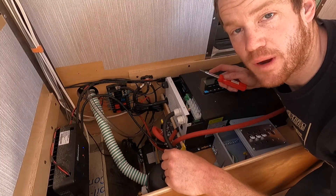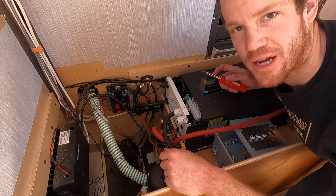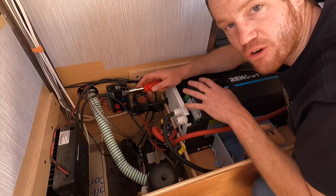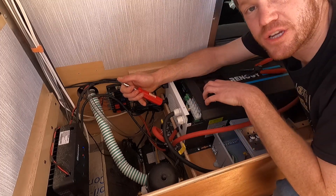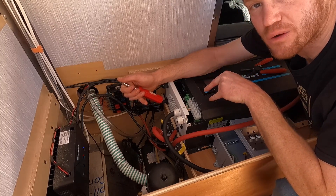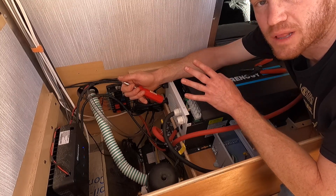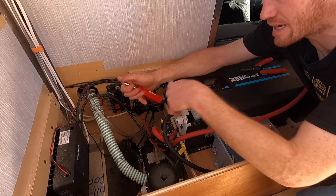It's really important that the neutral and the grounds be separated through this entire process. A lot of people say the neutrals and grounds are tied to each other in the electrical panel on the side of their house — they are only tied to each other where the ground actually goes to earth. So in this scenario we wouldn't want our neutrals and grounds tied to each other in the camper when we're plugged into shore power. What this Renogy inverter does is it has a relay inside that ties the neutral and ground together when we're not connected to shore power, and when we are connected to shore power, that relay disconnects and makes sure the neutral and ground stay separated, so we're grounded back at whatever electrical panel we're plugged into. That's why the neutral and ground are separate in our sub-panel and remain separate as they come into this inverter.